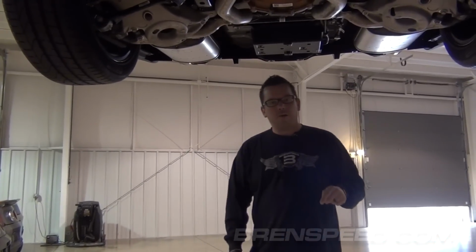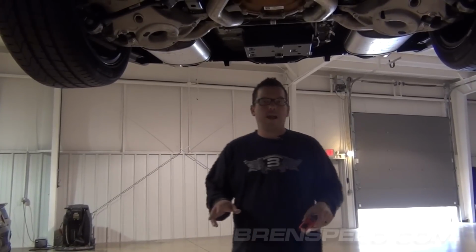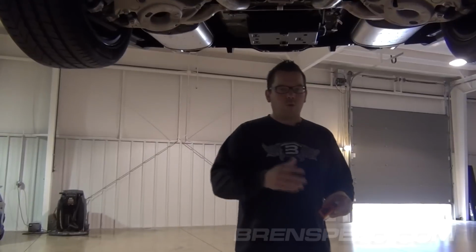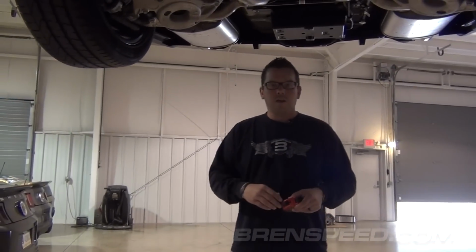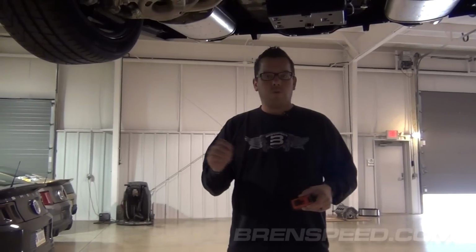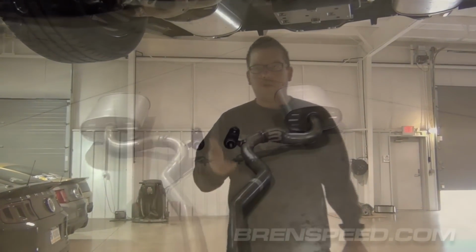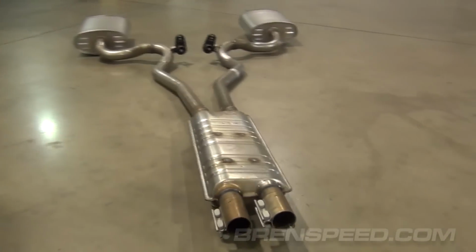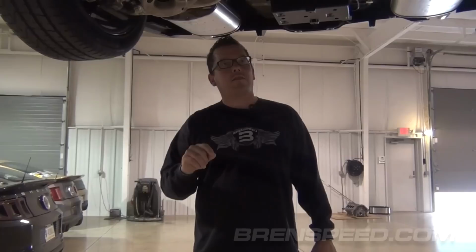What I wanna do right now is take a look at the exhaust we are gonna put on this. Ford Racing has a pretty huge variety of exhausts available. It comes in Axlebacks, Catbacks, Touring, Sport, and then you got GT, 2.3, everything in between. We're gonna put on the Sport, all right? The Sport is 49 state legal, they call it. All their Catback systems are emission legal because we're only going from the Catback. We are going to eliminate the resonator, but we're not gonna mess with the catalytic converters. So that's what keeps us emissions legal.